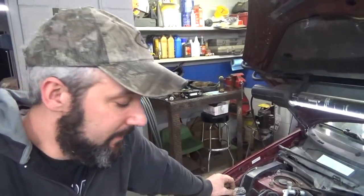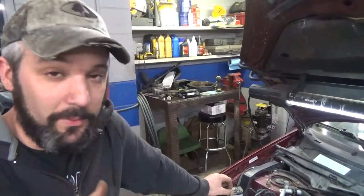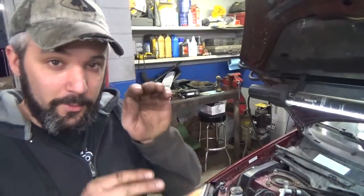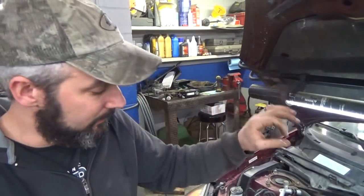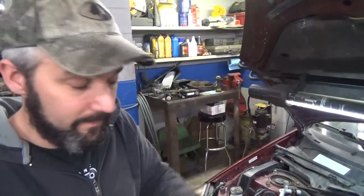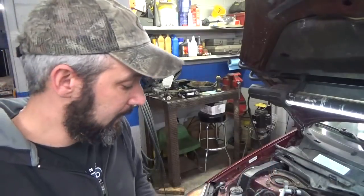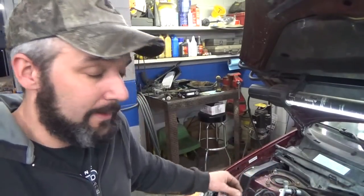Well, you know what stinks is I just put it on and I put the bolts in it, and I got thinking there's two bolts that run through the center of this cover. Right around those, there's little aluminum bosses that stick out that hit against the block when you tighten it down. Right around both of those, there's supposed to be some silicone. Will it leak out of them bolt holes, ultimately leaking down in front of the cover?